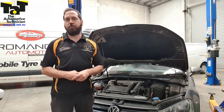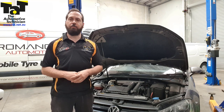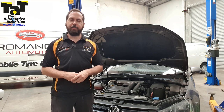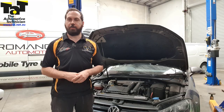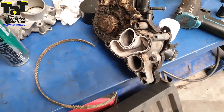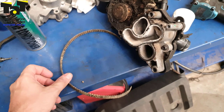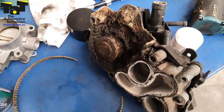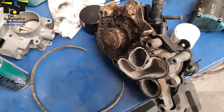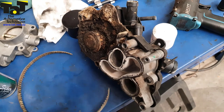I just wanted to show you what the actual fault is — it's a common problem because the water pump belts on these are very flimsy, and the belt actually broke. As you can see right here, this is the remnants of our belt — it just completely disappeared. Look at all the junk in that area. There was a bit of a leak and oil contamination around that area, which is what's obviously broken down this belt.